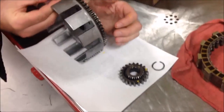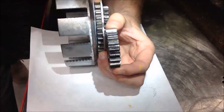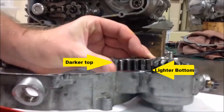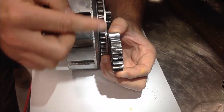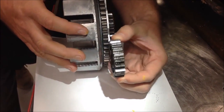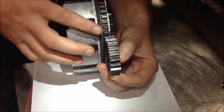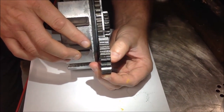We're going to talk about wear patterns. Can you see the difference in color on this gear? Here's a close-up — you can definitely see the different colors between the top and bottom. That polished side would have the heavier load, acceleration and deceleration forces. It shows a wear pattern where something's polished and shining. Take a look at this primary drive gear — it drives the clutch basket, and the width of the clutch basket matches the witness mark width of that polished part.